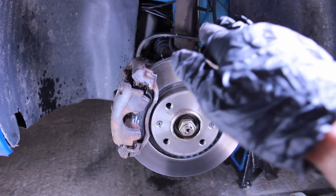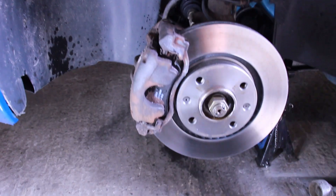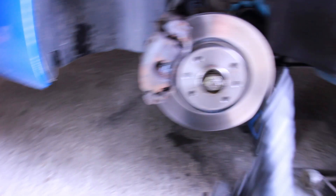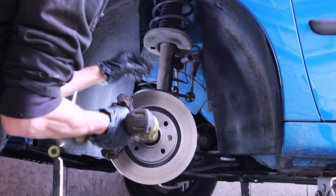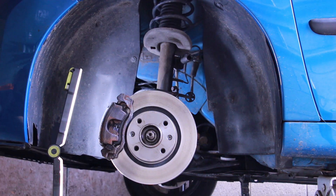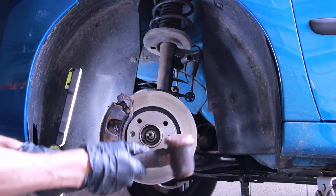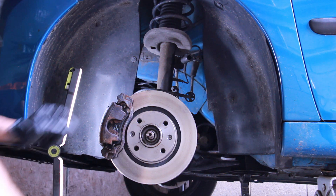First we're just going to give all the nuts and bolts a spray with some sort of release fluid — the anti-roll bar link joints, the nut that holds the brake hose on, and the nut at the back which clamps on to the strut. Give them a wire wheel too. Now to remove the centre nut on the driveshaft, you either lower it and put a socket through the wheel, or put a punch in the disc and then undo it by hand with someone on the foot brake. We've got a cheat gun so let's use that — this is what you need your 30mm socket for. Remove it all the way and then either put it on the end of the threads to protect it or use a copper hammer to give it a smack just to make sure it's moving. You shouldn't have to remove the shaft but it's good to have the movement in it so it doesn't pop out the gearbox when you're trying to get the strut out.